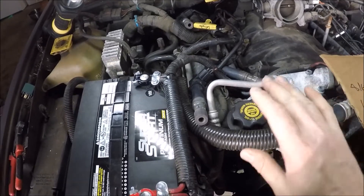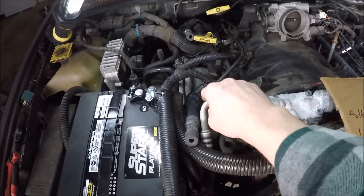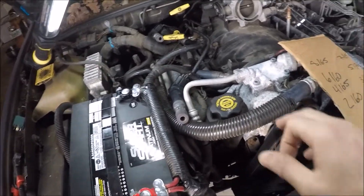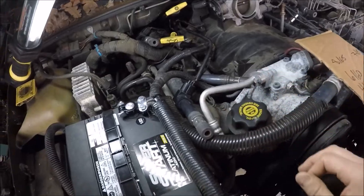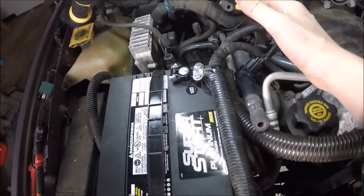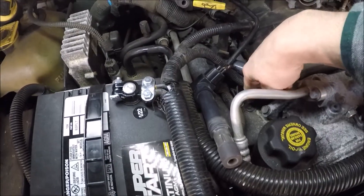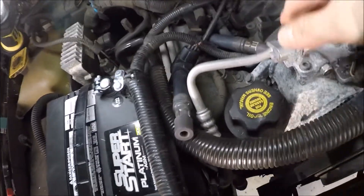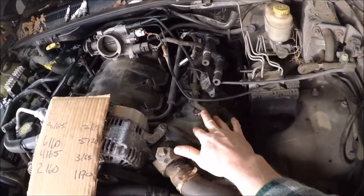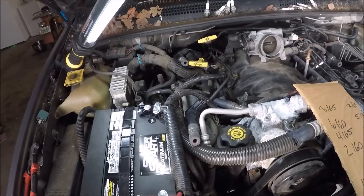I may have eliminated the valve seat, but I'm still not sure. Either way, I'm going to have to get dirty now and start taking off some covers. I'm going to start with the valve covers. The knock sounds like it's on the passenger side, so I'll try to get that passenger side valve cover off. I may need to remove the AC compressor and the oil fill cap, then push away some lines to get access. The bolts don't look terrible except for the ones at the very back. The driver's side looks a lot easier, but we need to get these valve covers off.